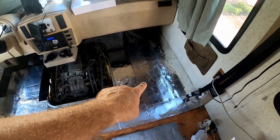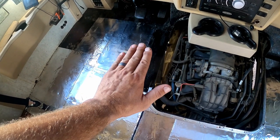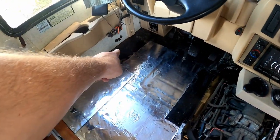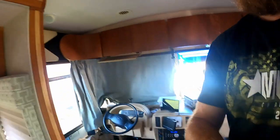All right, there we go — heat shield is all done here, it's good. I'm leaving this one section blank because it's kind of raised up and I don't want the vinyl flooring to be lopsided, so I'm leaving that uncovered. I just have that one little section there to fill in and underneath the controls down there, which I'm probably going to finish off later tonight or tomorrow. I used my grinder to hit some high spots from tack welds — and those welds were pretty rough, which usually means they weren't using the correct mixture or enough gas when tacking it together, either Ford or the body shop.